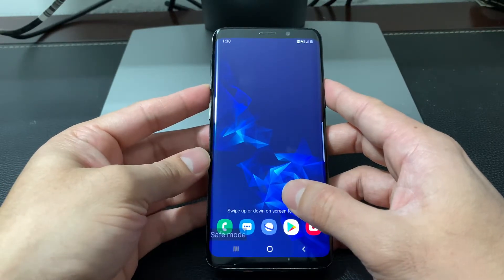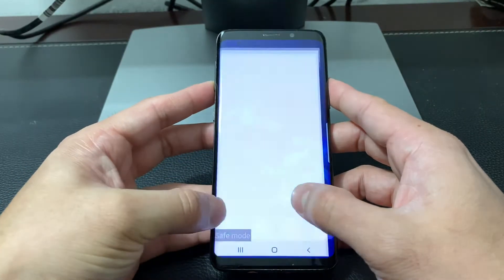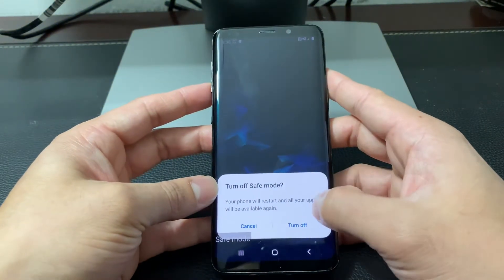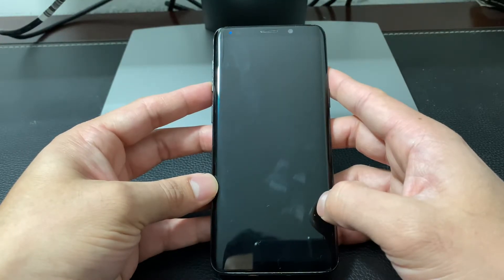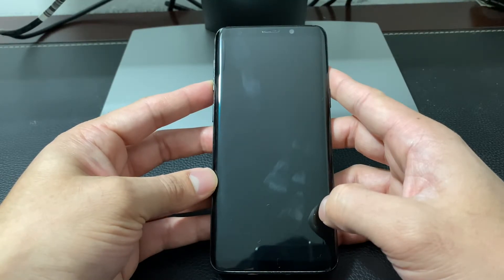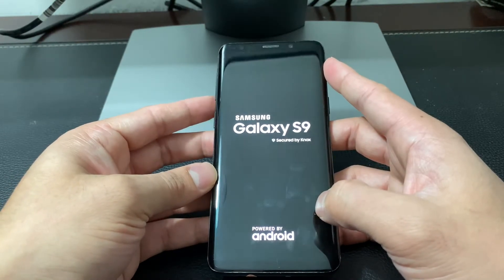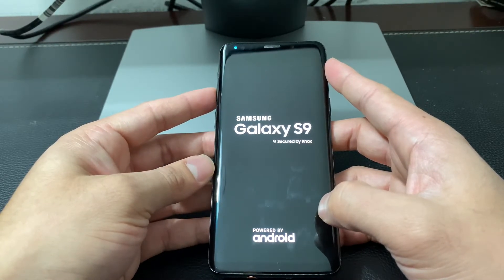This mode will disable some of the functions of your phone but will make sure the phone is able to start. So if the phone had a black screen or wasn't starting, this is a good way to get it going. You can turn safe mode off by clicking the pop-up and selecting 'turn off safe mode.' This is a good method to refresh the memory or fix issues with booting up, and it clears up minor issues from downloaded software or after software updates.